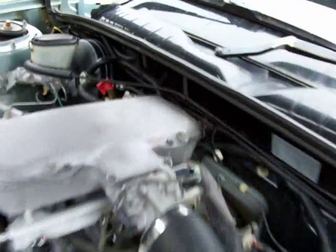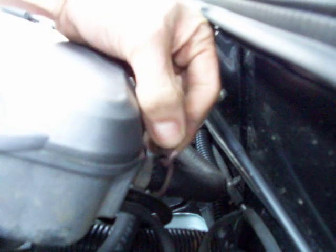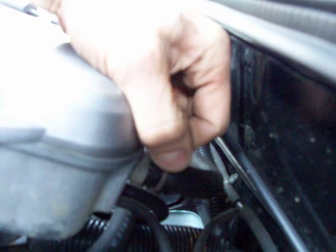The other thing is where these little hoses go on for the heating controls and stuff - they tend to come off and that'll cause a vacuum leak. I'd be checking these hoses here; that's the hose that goes to the brake booster. Because of the heat, they get hard. Here's something I didn't realise - this one's a tiny bit loose. The hose is still soft, still serviceable, so what I'm going to do is change this little spring clip for a proper hose clamp.